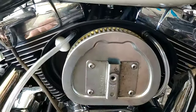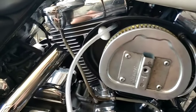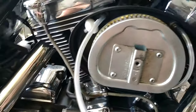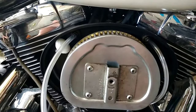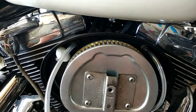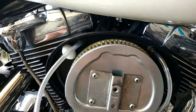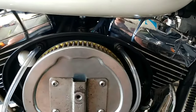Next, a quick look at my simple solution. It works with three different principles at the same time. The oil converts to a vapor in the motor in the heat of the crankcase. Harley had little Brillo pad baffles in each head, but they don't last. They wear out quick and you start getting all these oil vapors coming into your intake through these little S-pipes from each breather to the back of the air cleaner.